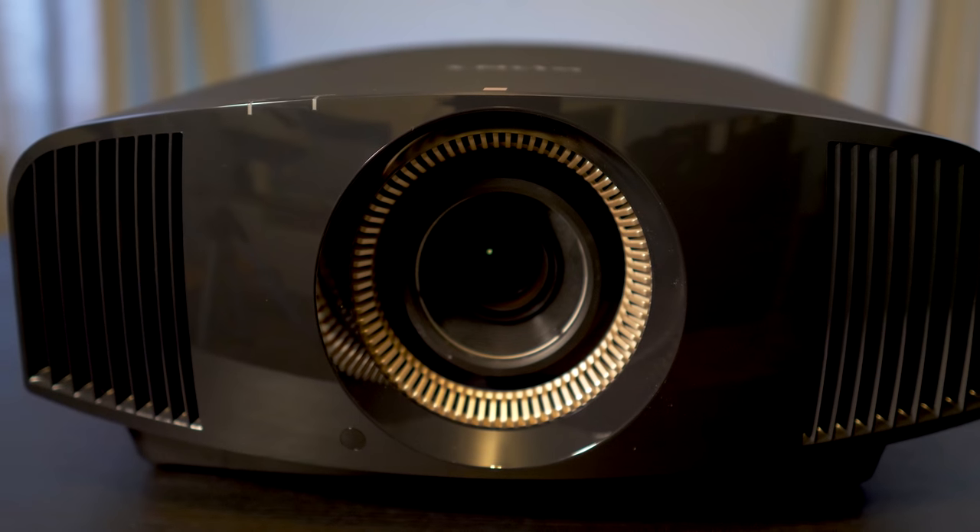So what's so great about this projector and should you upgrade if you have the older 675ES? I'm going to be honest — I didn't notice a drastic difference between the two models. This is a fresh out-of-the-box projector, so the image did seem brighter and more vibrant. But then again, the older one did have about 1,000 hours on the lamp, so there is a chance I didn't notice the image getting dimmer over time. These lamps are rated at 6,000 hours on low lamp mode. Aside from the image seeming brighter, sharpness and clarity seem the same. I haven't gotten the projector professionally calibrated yet, but using the Cinema One preset I found the image to look the most natural with a nice warmth overall. Sitting about 6 to 7 feet away in my first row of seating, I saw zero pixels, and this is with a 125-inch screen. Detail, as you'd expect, is ultra-sharp.